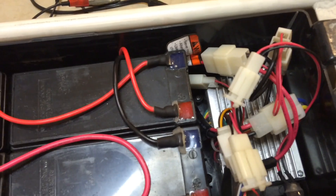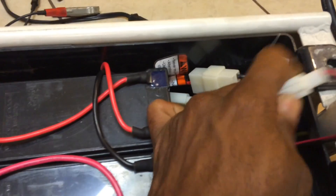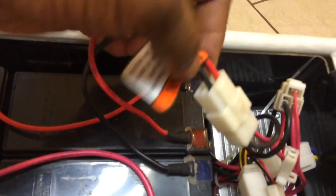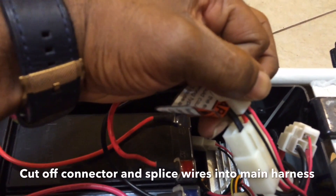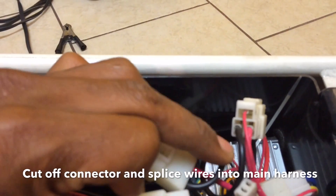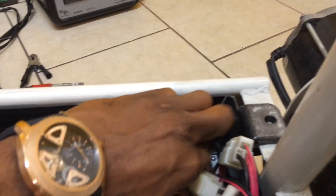The controller can handle another battery just fine, but for some reason it can't handle charging a 48 volt circuit. So you need to disconnect it here by pressing this tab in. It needs to come straight from your charging port. Trace down the main battery harness - this is your main harness because it goes straight to the batteries. Get out a voltmeter and confirm positive and negative, or just go red on red, black on black. Connect into the big gauge black and red wires and match them up - black to black, red to red.